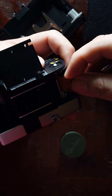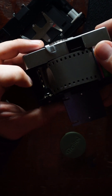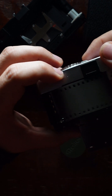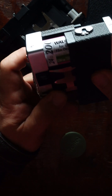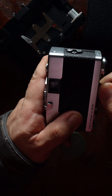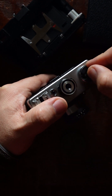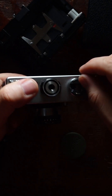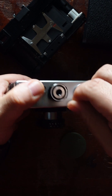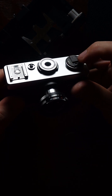You need to find this gap, shove the film in, and put this around. One thing that's kind of annoying to me: once I advance the film and fire a shot, what I do — applicable for other 35mm cameras too — is after advancing one frame, I try to rewind slightly. When I advance again I can see the film spool rotates, so I know the film is properly engaged.